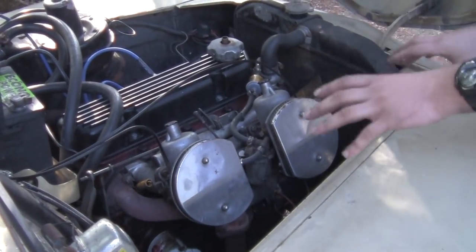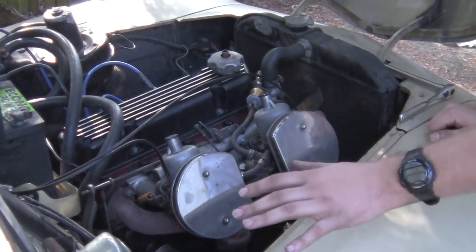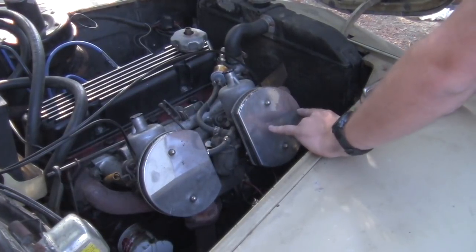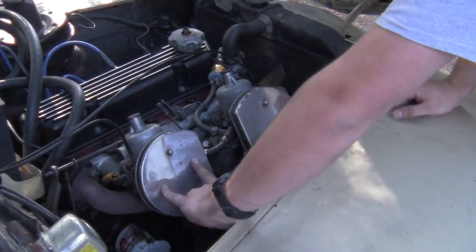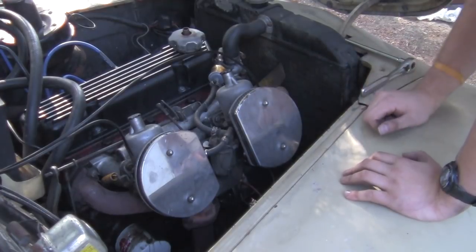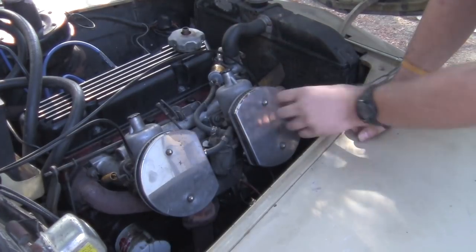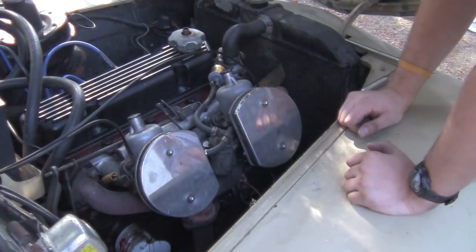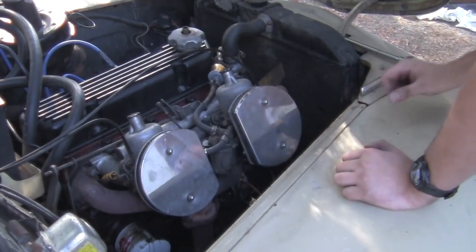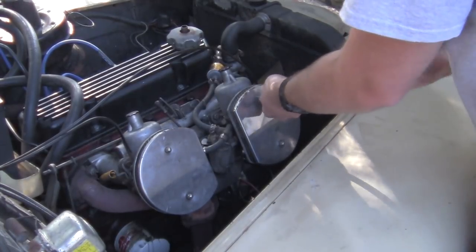You'll see on these carburetors I have some weird air filters — your air filters are very likely not going to look like these. This is some weird JC Whitney kit; this is how the car came and I haven't replaced them yet. What you will likely have are some filters held in with a couple of bolts. You'll either have a two bolt or three bolt variety. The three bolt variety is preferred because the body of the carburetor throat is threaded, making it easy to get bolts in and out. Let's get these air filters off and take a look in the throat of the carb.